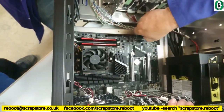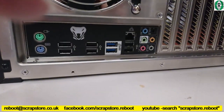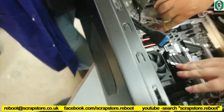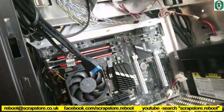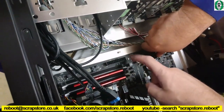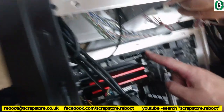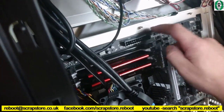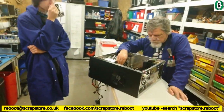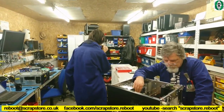Going in nicely. Right, have we got the same issue as we did with the last board? Overhanging, yes we do. See the problem, the last motherboard hole is here. There it is. You've got about 2-inch overhang and the 24-pin motherboard power socket is right there, and it makes quite a lot of flex when you're pushing that down. So if you could take the Lian Li cage back down, Jacob, and unstick the two little sticky grommets that I put in there, and we'll reuse those.